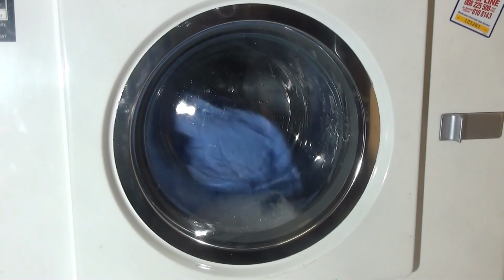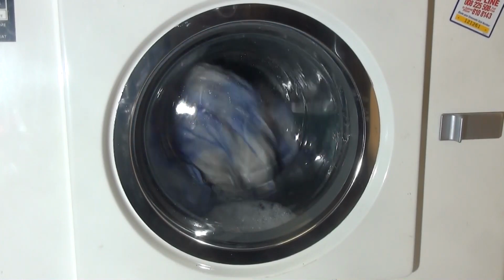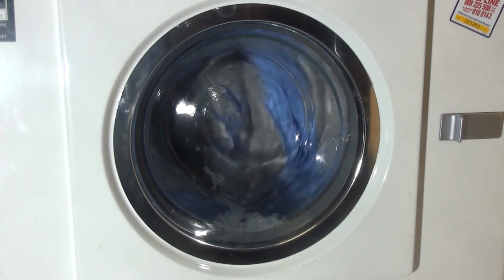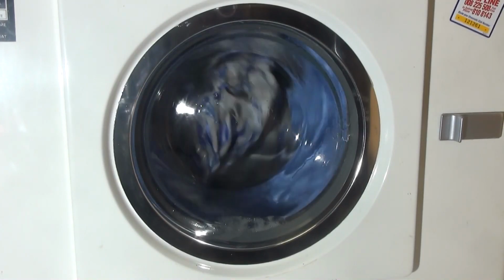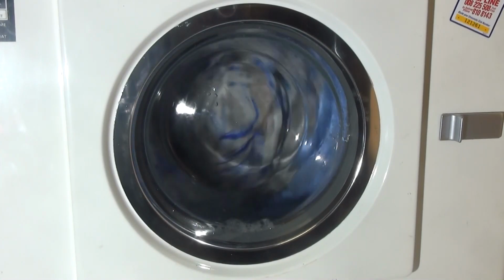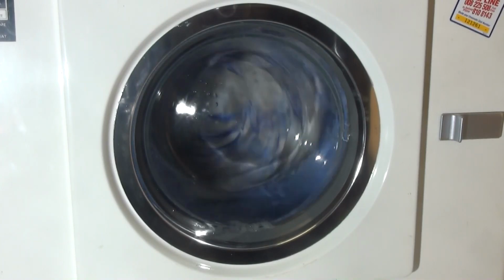But what we also found out is that you could trick it into putting more water in, if you had it overfilling at some point. No, I just let the hose pipe go. Yeah. But you can trick it, because with mini load, put mini load on and then take mini load off, it'll then add more water. But because it was timed, it'll add more water than it normally would.